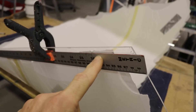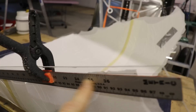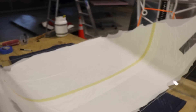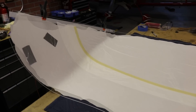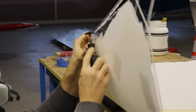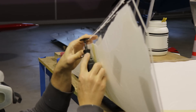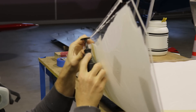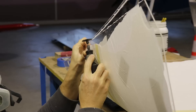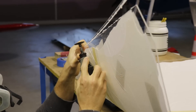When I had the windshield on I marked the new location of the back of the tubes. I put two little marks on there, then on the workbench I clamped this ruler and drew a line. So now I'll remove the ruler and go ahead and cut this part off. It's a little bit of a hassle — it's kind of a lot of work and it's messy to trim the canopy, but don't be afraid to trim it as many times as you need until you get that perfect fit. The technique I found helpful when trimming with this cutoff wheel and Dremel is to do about two inches at a time and lightly go back and forth over those two inches until it cuts through. One of the problems with this older Dremel is that when it vibrates the speed control keeps dropping to a lower setting, so I have to keep stopping and resetting it. I may have to buy another Dremel — this one's pretty old, I've gotten my life out of it.